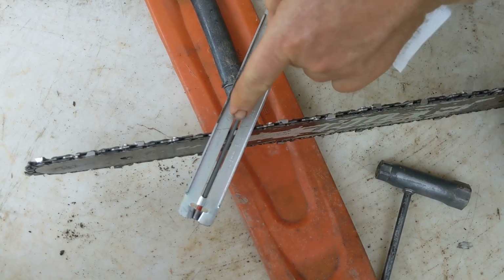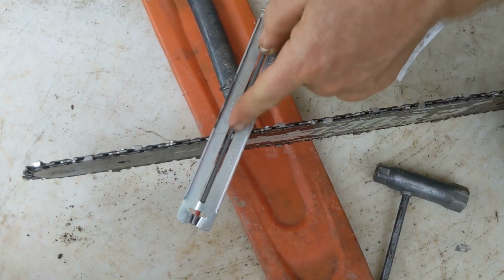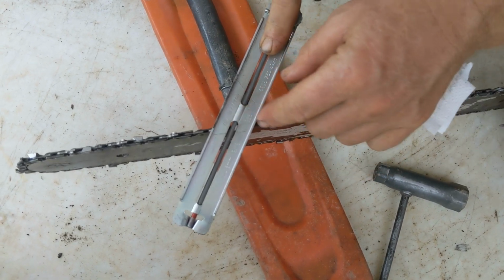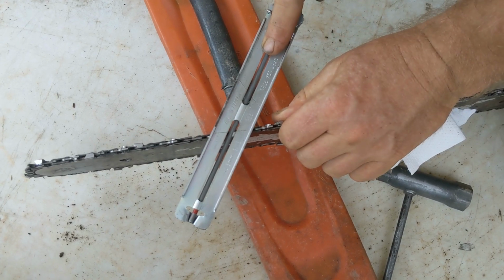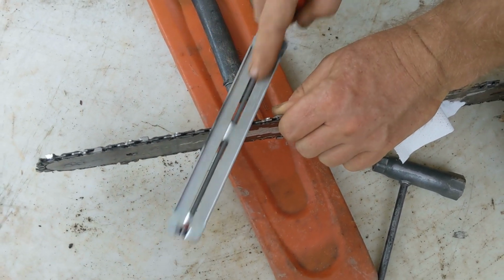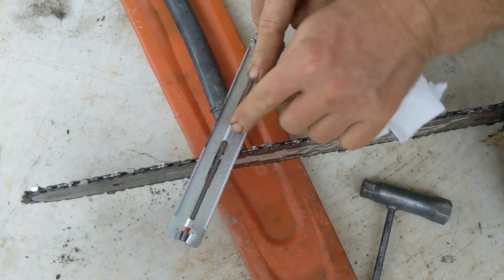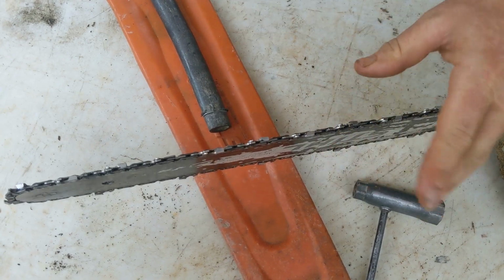Now, sometimes you can see that the tooth now fits. There's like no gap there. And sometimes you'll see it where you put it up against it, and you can see that it's rounded over. Okay, not quite good. We're going to do one more. So we'll say that's 5. That's beautiful. I can now see that that perfectly touches that at that angle. 5 strokes.